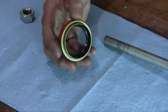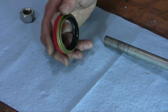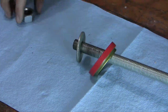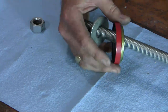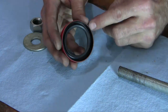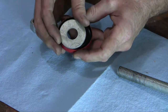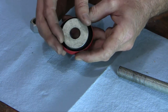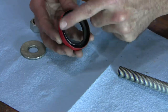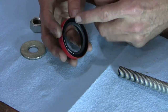This seal is at the end of a long tube — there's no way you can get a hammer down that long tube. The seal is designed to be pulled in from the inside out. What we've been doing is taking a threaded rod, sliding it through the seal, then using a big washer and a nut, and with one person setting the washer to line up with the seal, pulling it into place. But with this seal there's no flat surface to pull on, and ideally you want to pull on the metal parts and leave the soft parts alone. If the washer slides off, you're in trouble. So ultimately what you need is a seal driver custom made for this application.